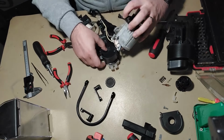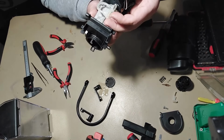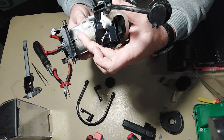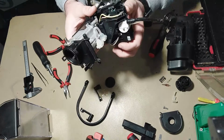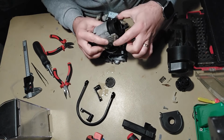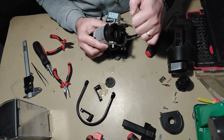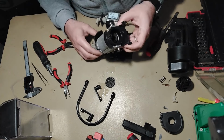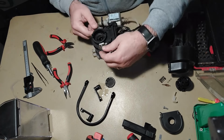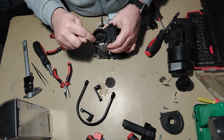Well, in case you see this, for example, oops, water is coming out from here. If you have a lot of lime scale on the heater element, then it's clear you have a destroyed O-ring inside, like this one. So in order to access it, you have to remove these two nuts here, take them outside, and then you can remove this plastic part and you will have access to it. This is easier said than done. But yeah, there is still another O-ring inside, a small one.